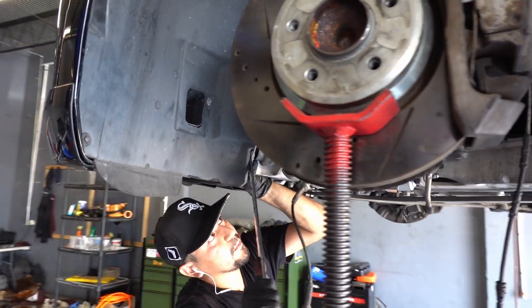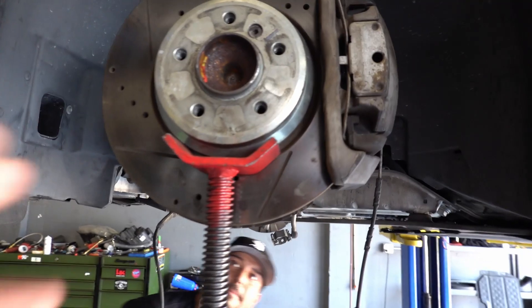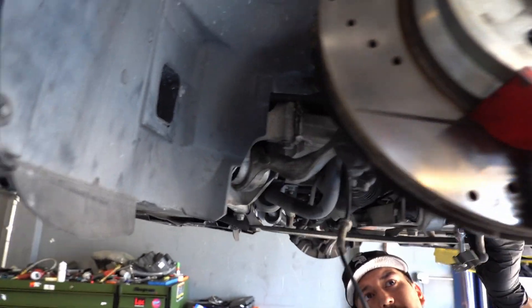You can see all the work Angel is going through over there. I thought about installing the coilovers myself, but once I watched a few videos on how to do it, I decided to pass and bring it here to Eurocharge. If you guys need suspension and coilovers put on your car, this is probably the best way to go — it's a little complicated and time consuming. What you're seeing here is Angel putting load on the suspension so he can properly tighten up the tension strut; not doing so would put too much pressure on the bushing.